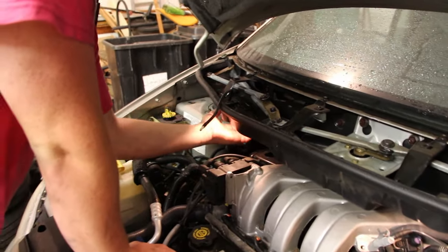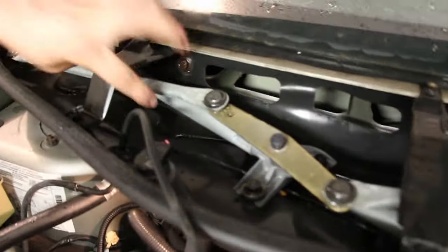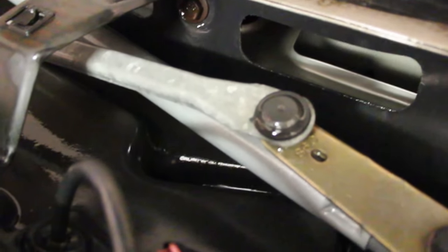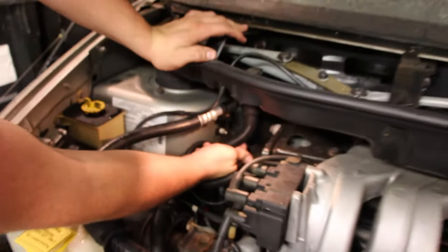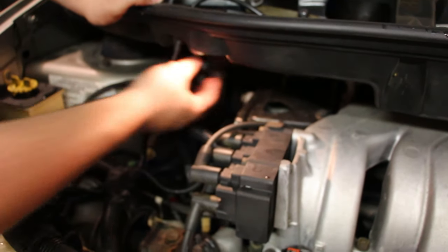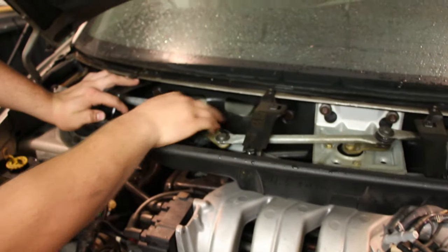What happened in this case — if you come in close — you'll see there are drains in this grate. It collects water, and down here is a drain. What had happened was it collected so much debris that it caused a clog on this side — there's another drain over on that side. Now when the drain's clogged, this hose, where normally all the excess water would go, gets clogged up and fills all the way up and starts dumping over into the car.